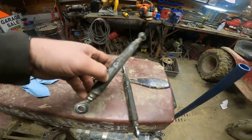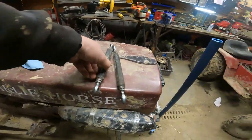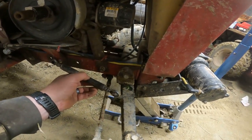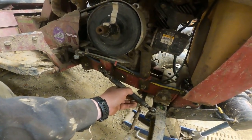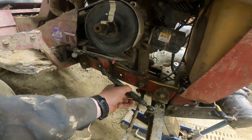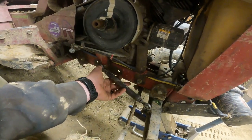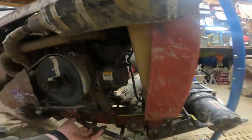Okay, we took these off and put some stock type back on, so we don't have a tractor down. So I'm going to use these off of there. I'm going to build a bracket, drill, bolt it with a hole like up there. And then that end will go to the tractor. I'll have to stand it off a little bit. It would be nice if it was back a little bit more, but I can drill through that. Put a standoff, just a spacer, a bolt or nut, I mean, or something, just to stand it off the tractor a little bit. It's not going to get a lot of this. It's not going to get hardly any of this. It'll be the up and down, and it'll be fine. And we won't get the back and forth.